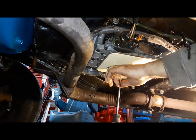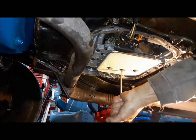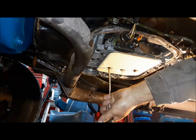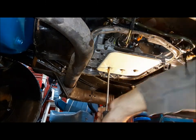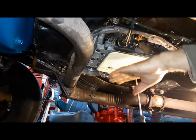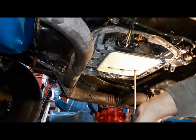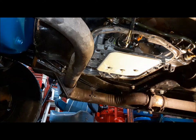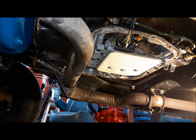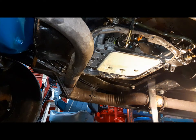Another thing we would do if we were really going to be working this thing hard — like towing big trailers, pushing snow, or even racing — we would put on a deep pan. The normal pan is basically here; the deep pan comes down further and it has a filter extension that puts the pickup right down into the bottom of the pan. I would also install an inline filter: you just pick the transmission cooler line — the out one — and put a remote filter head and an oil filter from a car on it, and that'll catch any little bits and pieces that get through.